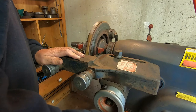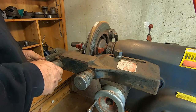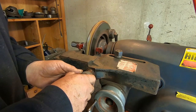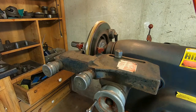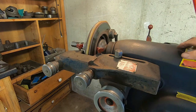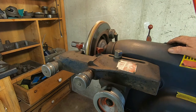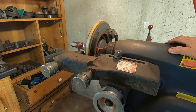I'm going to carefully bring each one of the cutters in about 4 thousandths, so we'll be taking off 8 thousandths of an inch total off the rotor. We have about 75 thousandths to work with before we hit the minimum thickness. So there I'm moving the lever to make the fast rough cut. In the interest of time I'll pick this up when the cut is finished.